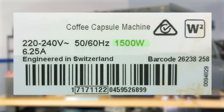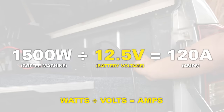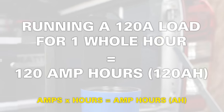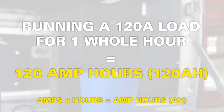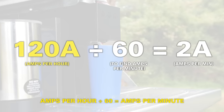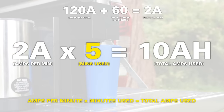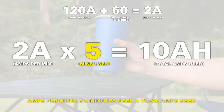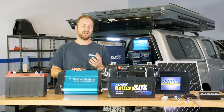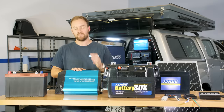For example, a coffee machine rated at 1500 watts with a battery voltage of 12.5 volts: 1500 divided by 12.5 equals 120 amps. If you ran it for a full hour it would draw 120 amp hours, but say you're just making one or two coffees and it's only on for five minutes — take 120 amps, divide by 60 to get amps per minute, then multiply by 5, and you get 10 amp hours for just five minutes of use. That's a significant chunk, but spread over two batteries it makes much less of a dent — another good reason to have extra capacity if you're planning a big 12 volt setup.